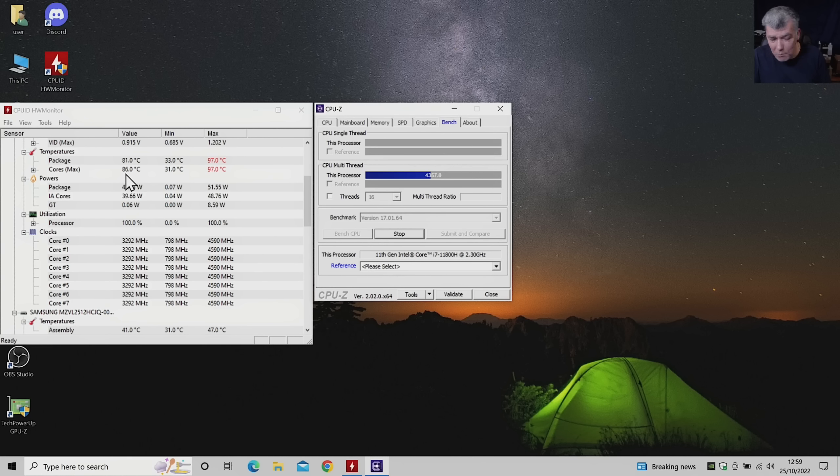This is a big improvement. What we saw before was only around 95 degrees — that's what liquid metal thermal paste does: 10 to 15 degrees better. I cannot recommend this and I cannot be responsible if you try to do it on your laptop — that's why customers come to our shop just for this, to replace normal thermal paste with liquid metal. But if you put just a little bit, nothing wrong can happen. There shall not be liquid metal floating on your CPU or heatsink.